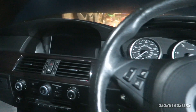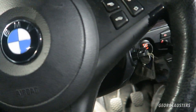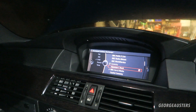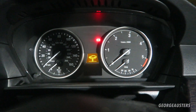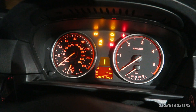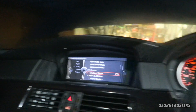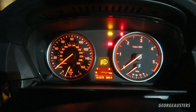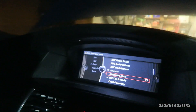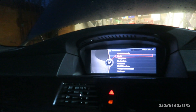We are in the car. As you can see, we have power because the battery is now connected up. I'm not going to attempt to start it yet - I'm just going to check what the oil level is showing, so I'll just put the ignition on. We have an increased battery discharge warning, a service light on, glow plugs, ignition switched on. It's asking to set time and date, and there's a front fog light failure - that's because we haven't got the fog lights plugged in. Fairly standard stuff, nothing much to worry about at the moment.